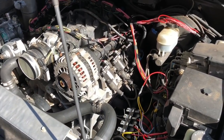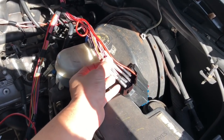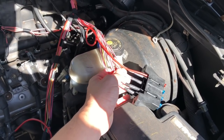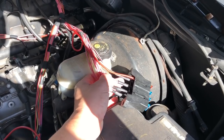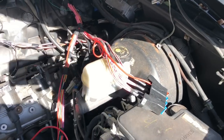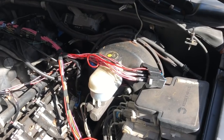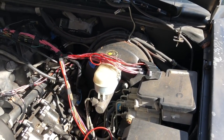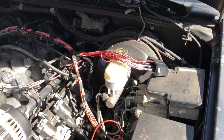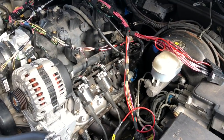Here's how I went about getting everything started: I used a fuse block. One group is from the passenger side, one is from the driver's side fuel injectors, the other four I'm not exactly sure where they go, and two go to the computer. I grouped them similarly so that if I have a problem, I know where to look. I'm also going to label them on painter's tape and put it inside the wire loom so I can trace it later.